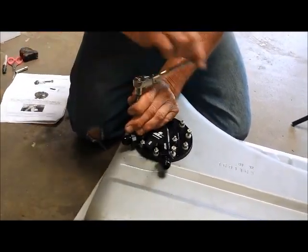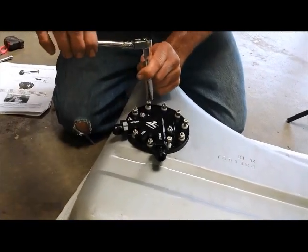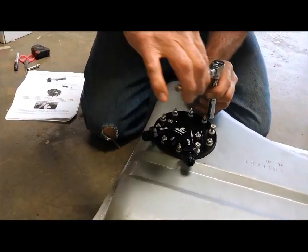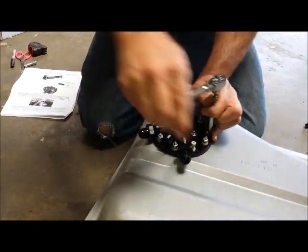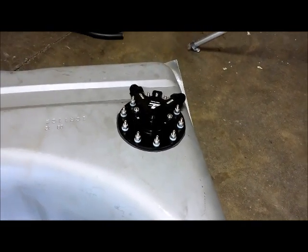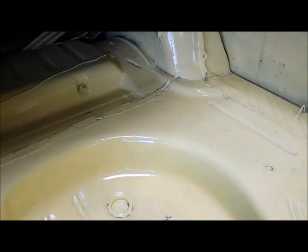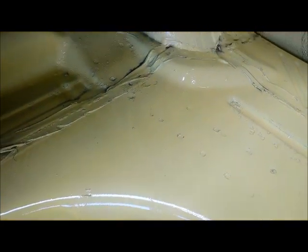One of the things you can't really see here is that there is a flexible elastomer that compresses, going between the fuel tank and the pump itself. That conforms with the shape of the tank, so that if you've got a tank with a lot of ribs and you don't have the luxury of having a large flat spot, it will seal the pump just fine with no problems. Next we're going to put the tank up underneath the car and see where we need to cut our access hole, because this is going to be quite a bit taller than we have room for, so we're going to cut pretty much a square shape.